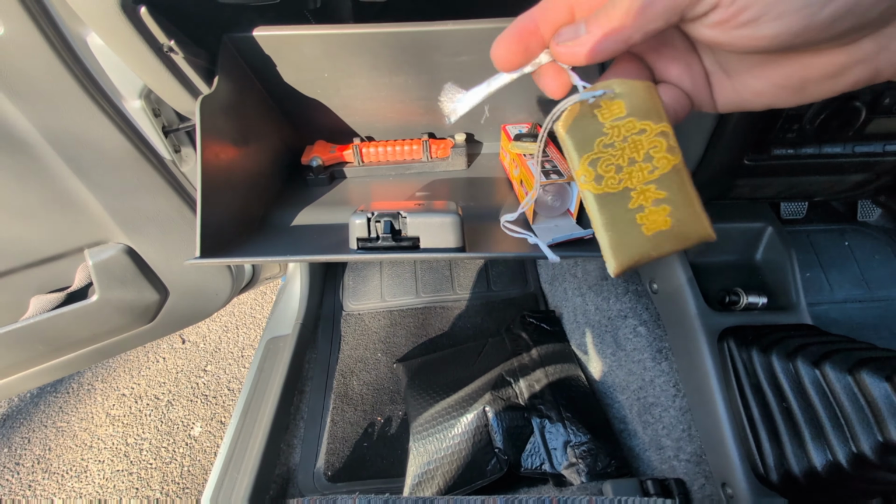And let me show you the steering box. So here we have the steering box. It doesn't have your standard power steering, where normally you would see lines and there'd be a pulley for it. In this case, it just has, I believe, what they call an electric assist, if I'm not mistaken. It looks like it might be leaking a little bit.